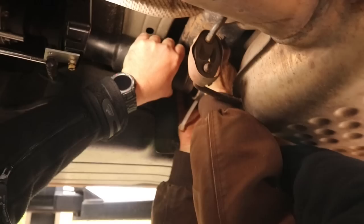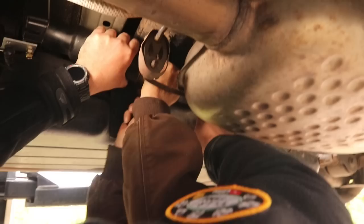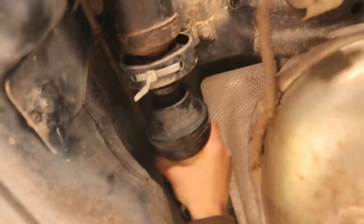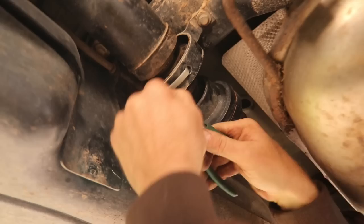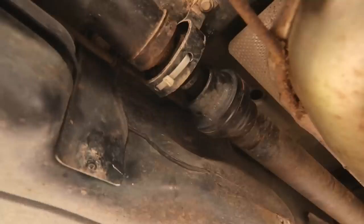I'm not sure what he wants to do there. I want to keep the drive shaft from bouncing around, and that's it. That's an anti-drive shaft bounce that we install. Oh my god. This is my construction: two holes and a tie wrap. Hold down the center bearing and you see it's tight now. So this is the trial repair for the center bearing problem. Now we're gonna do the same test drive again and see if this problem is gone. You know, it's just an interim solution. What are you talking about? That's the next 10 years it's gonna stay like this. It's Joachim's car. I love steel tie wraps. Yeah, we'll put a steel tie wrap around it for him and that's it.